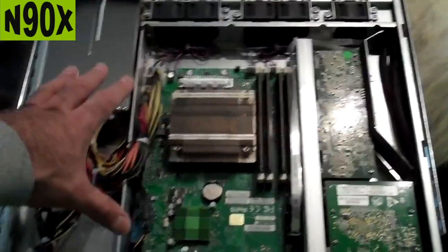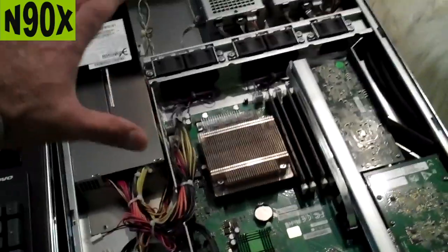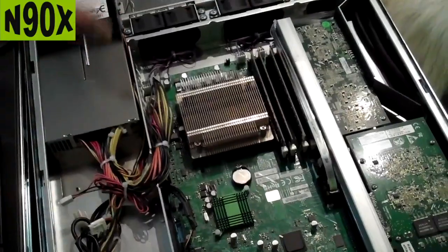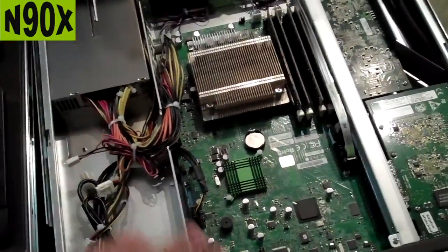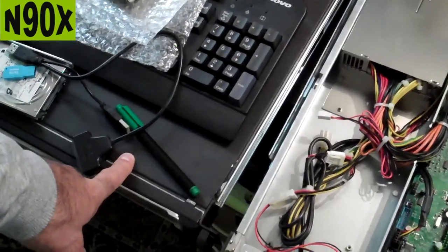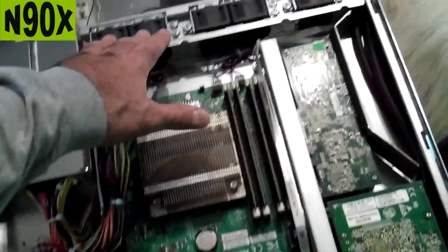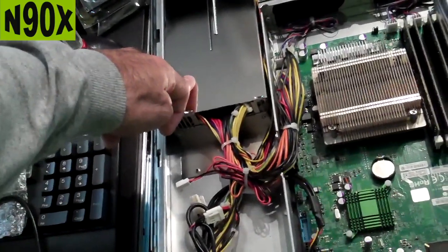What's great about this one is it's very quiet. In the BIOS you can set full speed for the fans or you can set automatic. When you set it to automatic, at boot-up time the fans race at full speed for a little while, then it cools down and slows down — it is very quiet. It's still noisy, but compared to the MPX-870-500 or the 5500, it is very, very quiet. It only has five fans in the case, and of course the power supplies have their own fans.